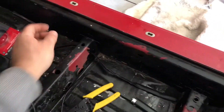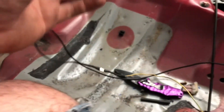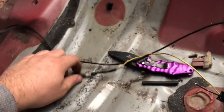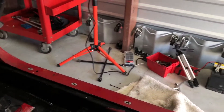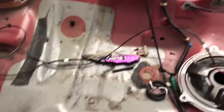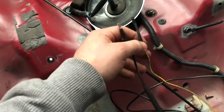Here's an overview: the ground wire comes off the fuel pump, and the power wire runs to the relay. On the back side of the relay is the switch. Two wires run down to where the battery will be, along with a 30 amp inline fuse. The signal wire on the left is the 12 volt signal coming stock from the car, and the last pin is chassis ground — we sanded the chassis there for a good ground. That's essentially how you convert your stock inconsistent 12 volt fuel pump to a consistent 14 volt setup using a standalone relay.